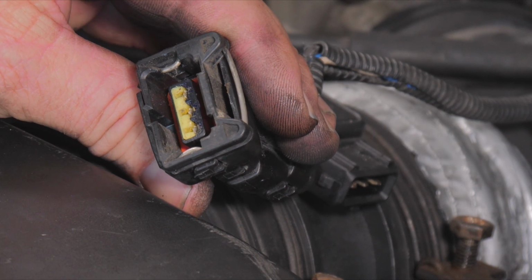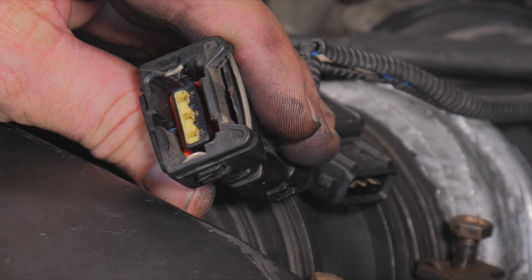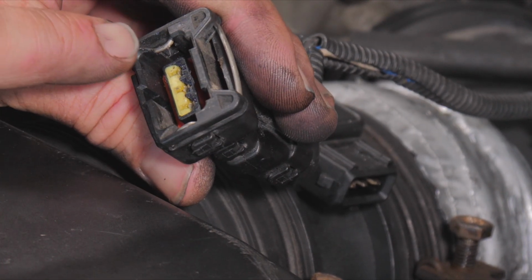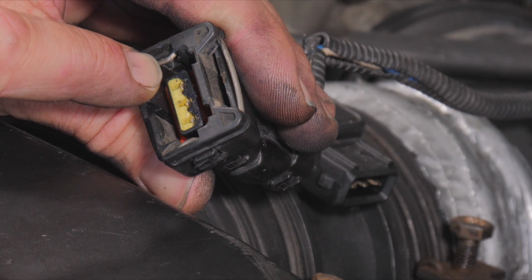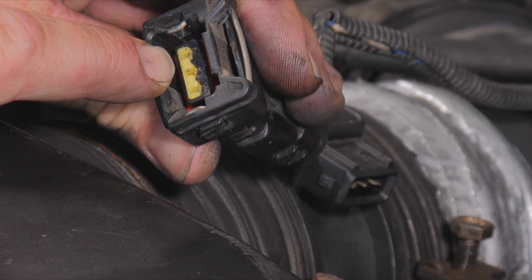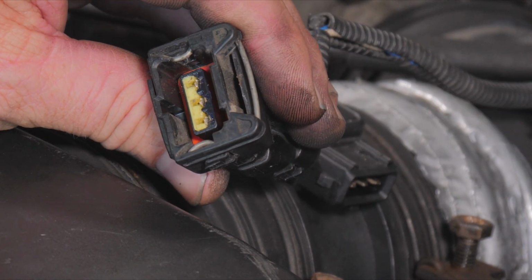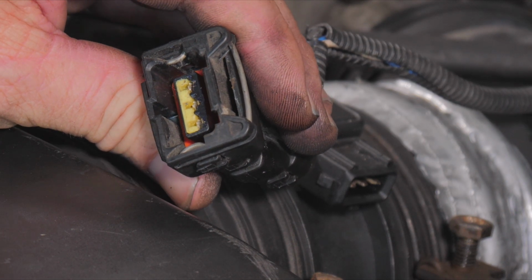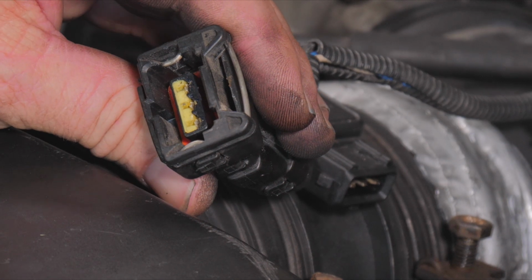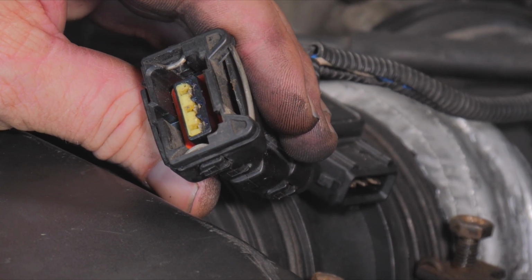But to keep on going on the wiring, that code could be the PCM, could be the wiring, open or short. So checking that wire for its integrity would be one. The same with the middle. The middle is the returning signal. So what we were seeing, that voltage that was stuck at 0.02, that would be where this wire, that would be the sensor going out back to the computer, telling it that's where that signal comes from.